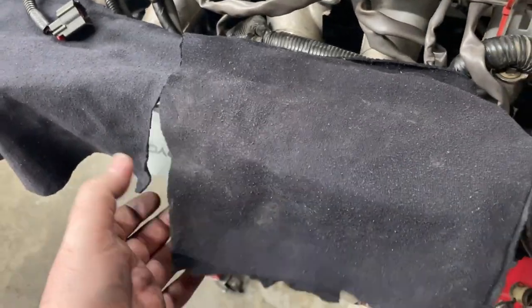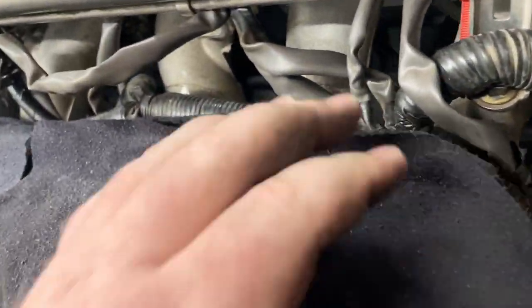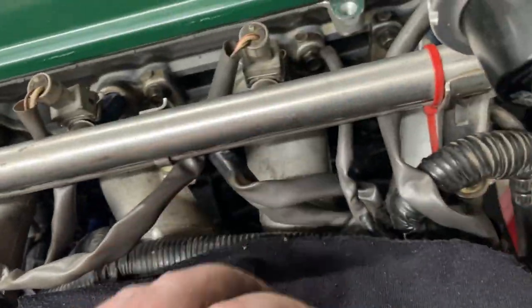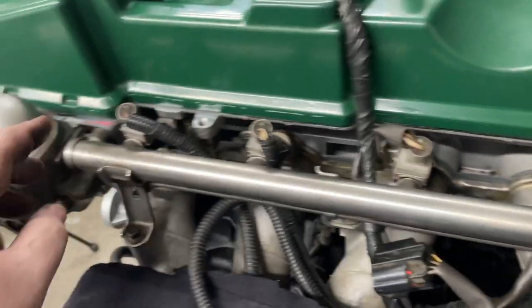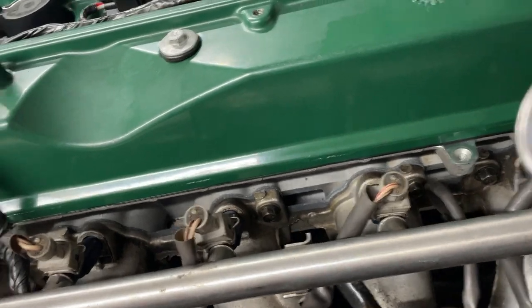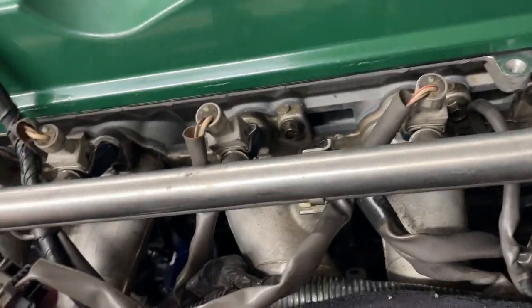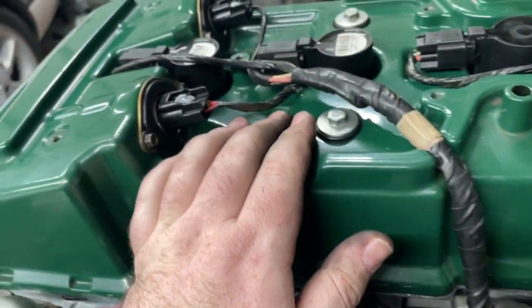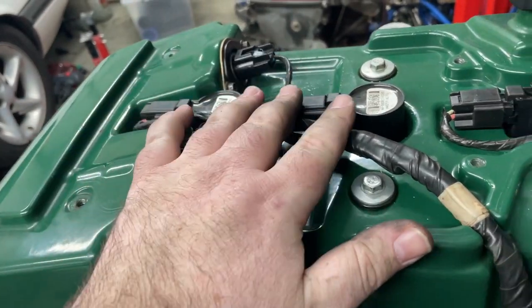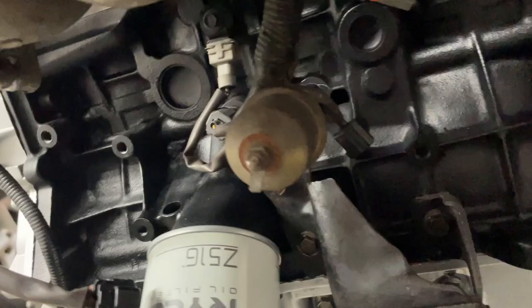I've just got these here to stop stuff falling in the manifold. Down here we've got the main harness, which comes up through there and runs down the middle. Then there are sections that branch off. You can tell in line where the injector plugs are, because they're in order of how they come out. Two connectors for the throttle body. Another section branches up to the top to do the VCT solenoids and the front two coil packs. Then down below,